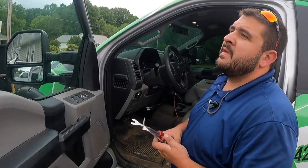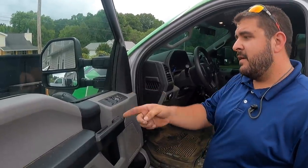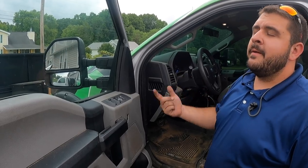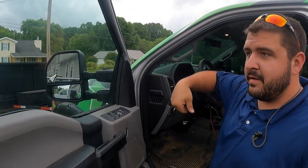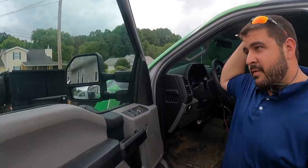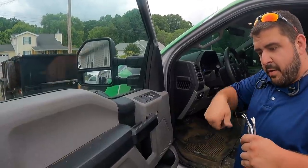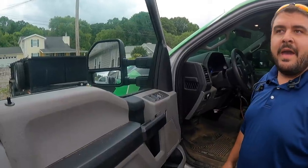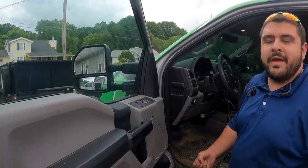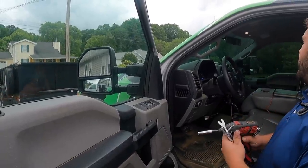Is there a huge difference between the bigger factory manufacturers? Yeah. I mean, the way they put things in — a lot of manufacturers start copying each other. The foreign manufacturers, they all copy Ford. When they started doing the cowls that snap in on a retainer on the windshield, most cars are doing that now. It's aggravating because you don't have anything underneath the windshield to push to snap that into the retainer, so sometimes you can't get it back in there.